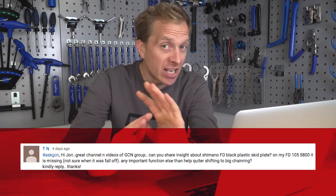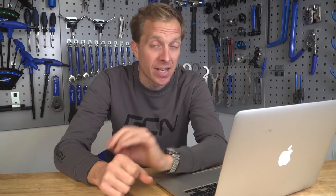The final question this week is from TN, who wants to know what I know about the front derailleur plastic skid plate. I didn't really know anything about this up until recently — well, I did know about it, but I didn't know what the name was. That black plastic skid plate actually does help with the shifting of the front derailleur — instead of metal on metal, you're going to have metal on plastic, and it just makes it a little bit quieter too if your gears aren't perfectly set up. That's no excuse though; make sure your gears are set up well. They mentioned it had fallen off. I'm torn between the two — it is there for a purpose, but we did survive for many, many years without them. So unless you are really finicky about it, you could probably survive without, but you can also buy it as a replacement part from Shimano.